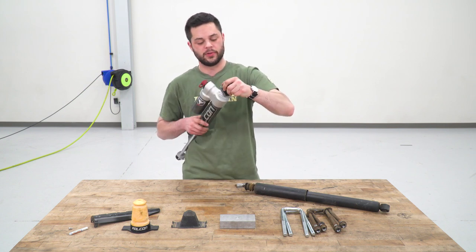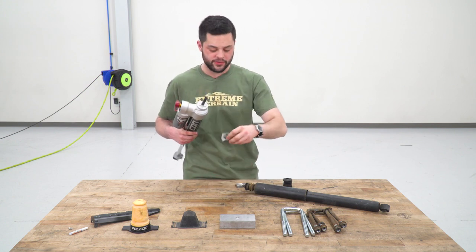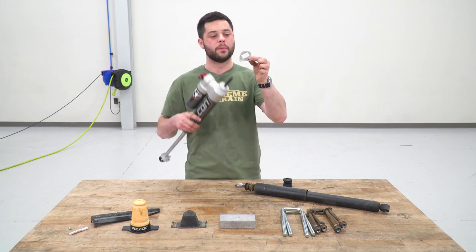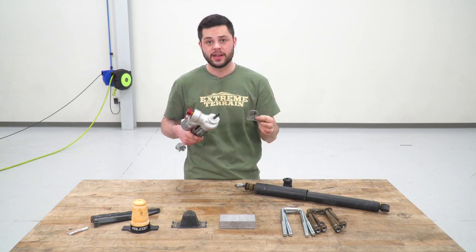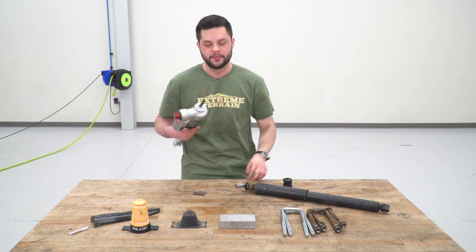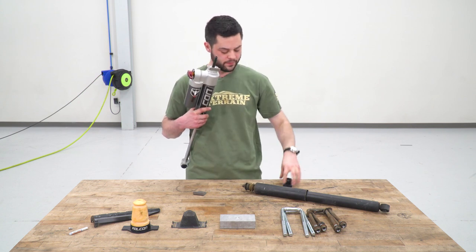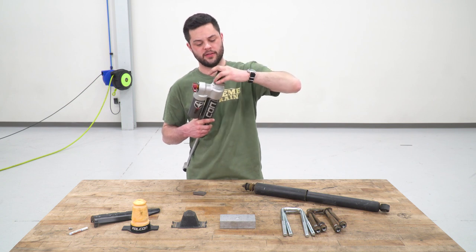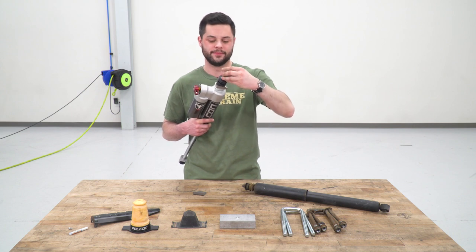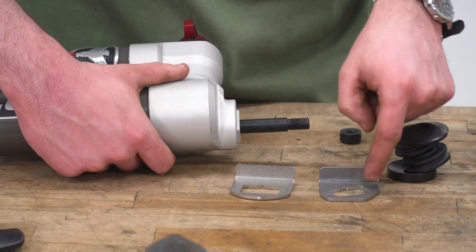Now what we're gonna do is pull off our bushings. And then this is gonna go aside. You can see how this is biased to the side. That little turn right there, that's gonna move the reservoir out past the bucket and allow everything to clear without cutting. Again, this is what you're gonna wanna use if you have aftermarket wheels that cut down on the backspacing. Factory wheels, we're gonna use this one. That's a perfect 90. That is gonna go on there. Then we could reinstall our bushings. And for the time being, I'm gonna put the top bushing on and hold that together with a nut. This is factory, this is aftermarket.